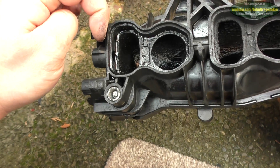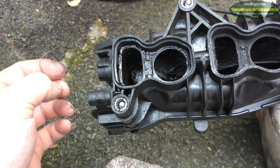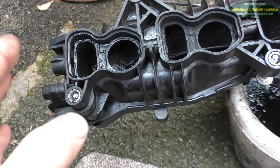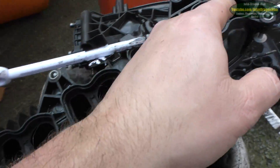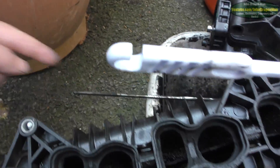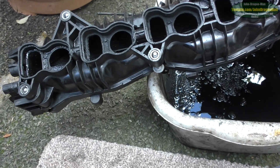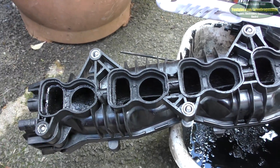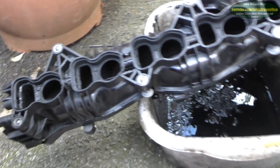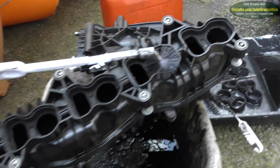You then have to remove - there's like a little arm here - and you have to very carefully get a screwdriver underneath the lip and lift it over this bit of a lip here. You can then remove that off - that will come straight off. Then what you do is you have to get a pair of pliers. I recommend you use some penetrating fluid like WD-40 and spray each of the swirl flaps all along it. Because it's going to be very difficult to pull it out - this bar runs all the way through the whole lot. I just used some of those pointed pliers. You've got to wait for the penetrating fluid to get all the way in and keep giving it a good dose of it. Eventually you'll be able to pull it and it will come out a little bit. I used those nail puller kind of pliers on the bar and managed to extract the whole bar through.